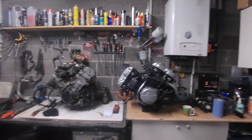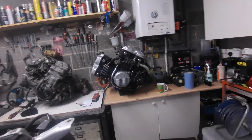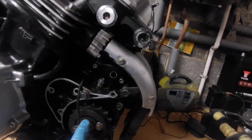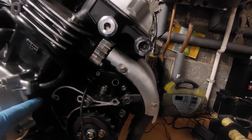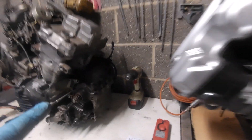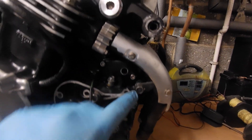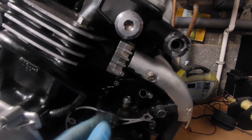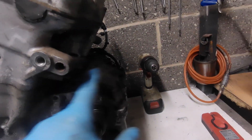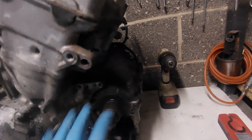There is some DNA in the two motors — you can clearly see things were carried over, but to all intents and purposes they are completely different as well. They didn't put this bearing in the split line of the crank cases — the split line is behind this cover and they set the bearing in the bottom half, in the lower crankcase half, whereas that output shaft bearing is in between the two. It's also a lot busier in here around the selector drums. There's an electric drum and selector drum down in the bottom, whereas on the other one there's just nothing there — a lot less busy.